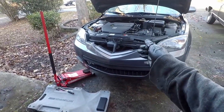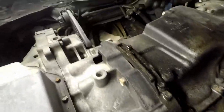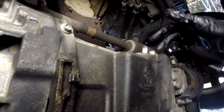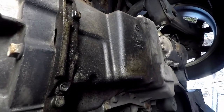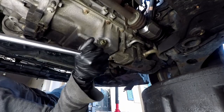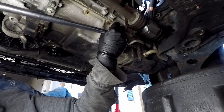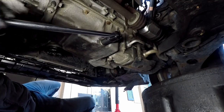Under the car, the engine is warm — not blazing hot, but warm — so the oil is gonna drain out nicely. On the back here is the 17 millimeter drain bolt. Got my drain pan under it, let's crack it loose. It's on there pretty good, so bringing out the breaker bar — every car I own, the drain bolt is always on there real good. Okay, broke it loose.